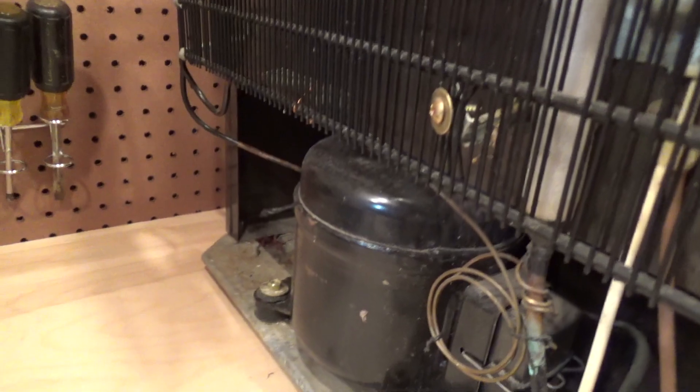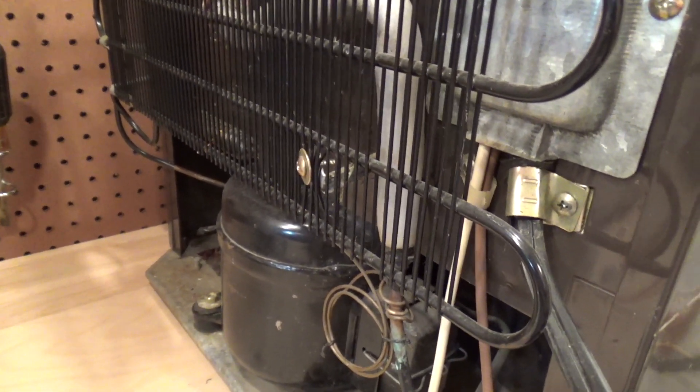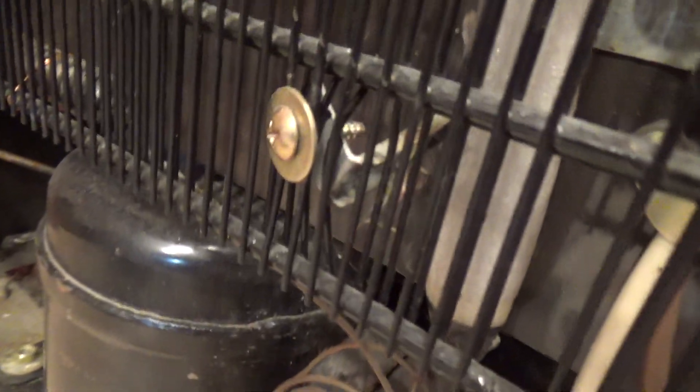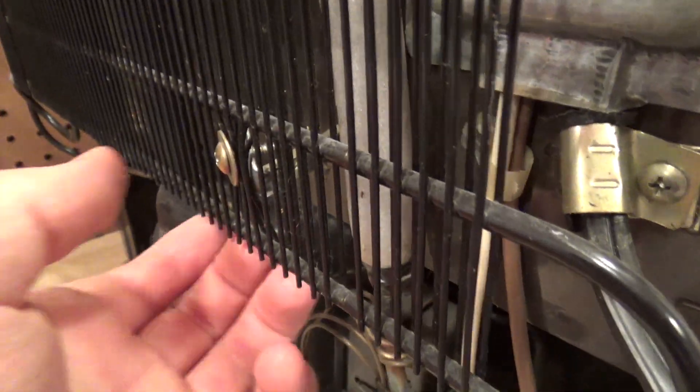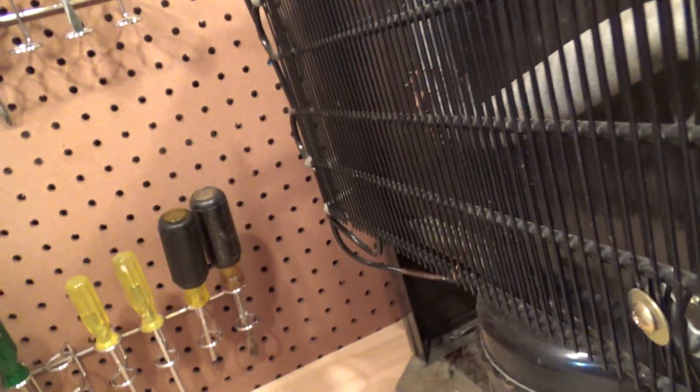It's cold — works fine, as would be expected, because R12 is low pressure. Paired with a good quality coil it'll almost never leak, and this thing has definitely taken some abuse over the years. This part is all bent up here, and this is bent in like something hit it. I'm not going to mess with it because if it's not leaking now, it's definitely not impairing the flow of the refrigerant. You just leave it alone — if I start messing with it something's going to break.